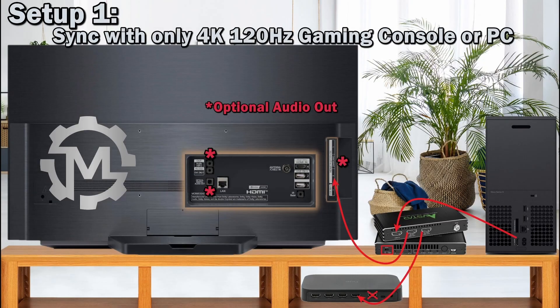In this section I will walk you through a Stage 1 setup that allows you to sync your 4K 120Hz console or PC. It assumes you're using your console or PC as a primary streaming device and allows an optional receiver or soundbar. You have a 4K 120Hz capable TV, your 4K 120Hz gaming console or PC, the AVStar HDMI splitter, as well as your Hue box. You're going to take your 4K 120Hz output from the Xbox to the AVStar HDMI input, then take the 8K CEC HDMI output to any available HDMI port on the TV that supports 4K 120Hz.